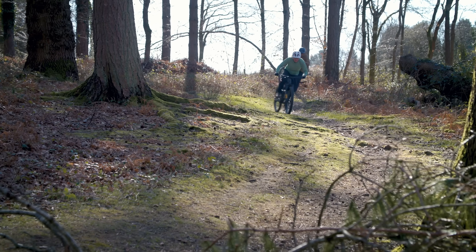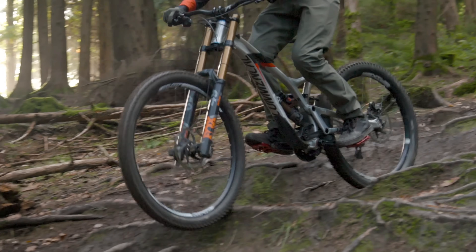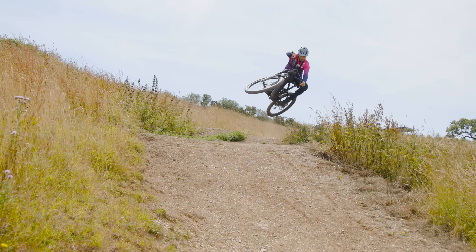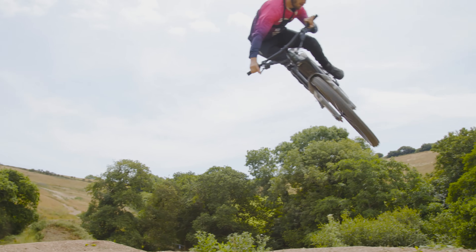Get this out on the trail and give it a ride. What about coil forks? You don't really get many coil forks these days — the progression you get in an air spring makes it easy to tune on a fork where the ratio of suspension movement to spring movement is one-to-one, whereas on a rear shock it's more progressive, which asks more of the spring. Top tip: look at the bike manufacturer's recommendations for spring rate if the bike is supplied with a coil shock. If not, go online — there are fantastic spring calculators that will calculate the spring you'll need based on wheel travel, shock actuation ratio, and your weight. There's a really good one on TF Tune, for example, but other spring calculators are available.